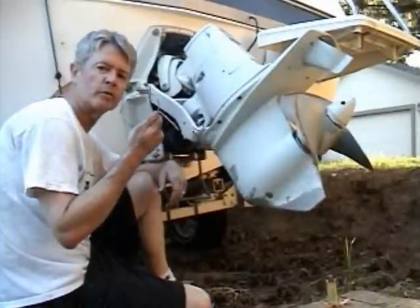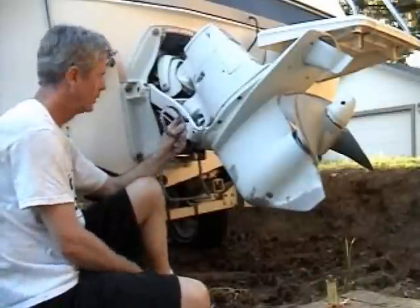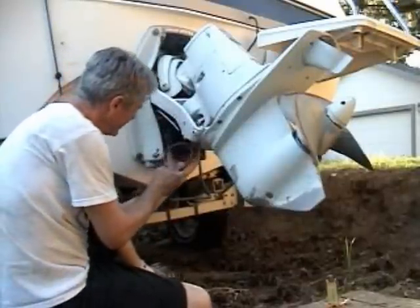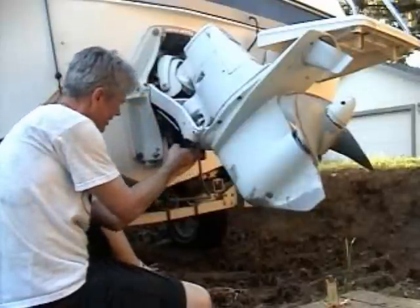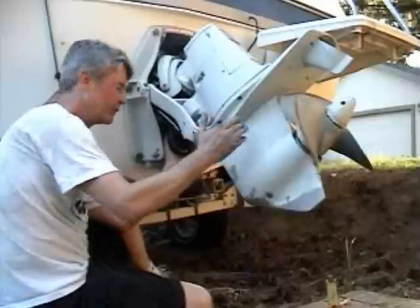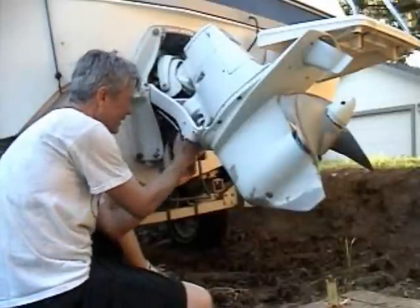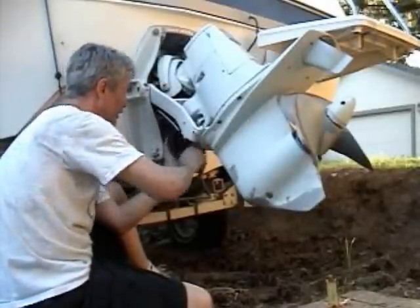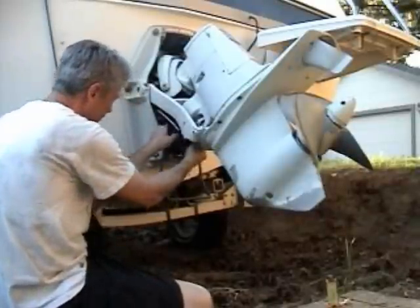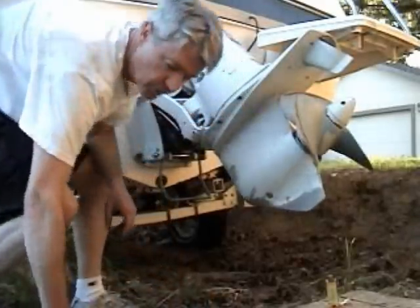So all I have is one more hose clamp to put on. I'm going to put it in a location that's easy to access. I'm going to guess the bottom would be easiest for me. Look at the way it was on there before. Yep, right at the bottom. I can move the Outdrive down some now because I'm pulling on the rubber to get it up there, and it has the same lip on the inside. Let's see how hard I have to push or pull. Yeah, I'm going to drop it down some to meet that. So I'll do that.